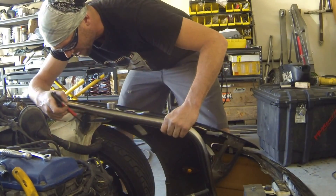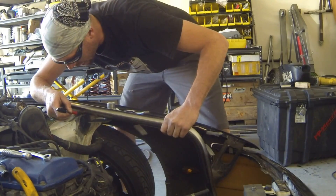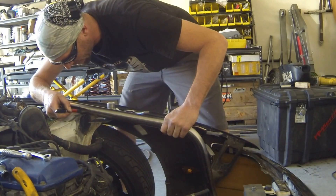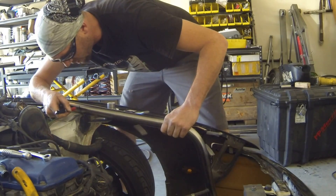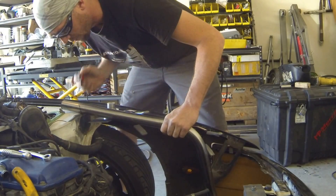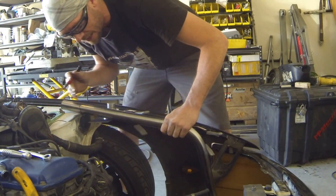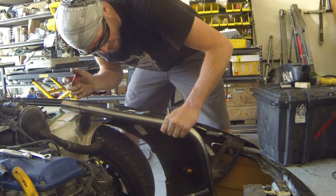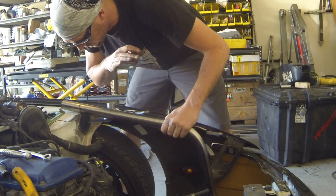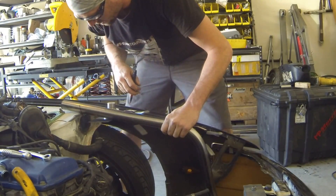On this one I'm going to mark the side of the tube because that's going to show the actual angle at which this needs to be cut. Going upward like this, we'll mark the length and the angle at which it needs to be cut. I'm going to feed this into the saw and I'm actually going to undercut this only slightly so I can allow some movement and adjustment. We're going to have to put the headlight bucket back in again to make sure we got it fit and set up correctly, so we'll run this back in and see how close we get.